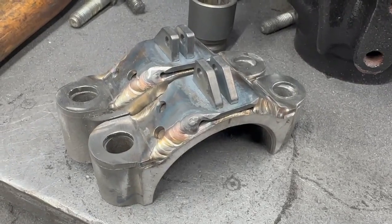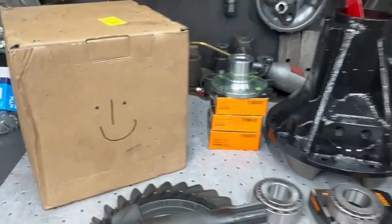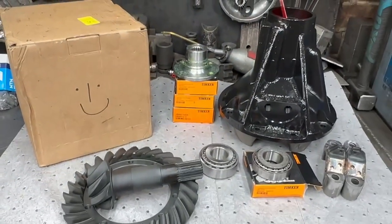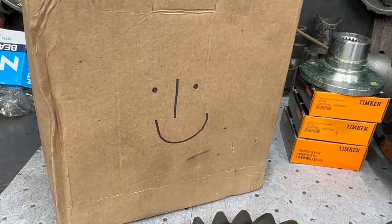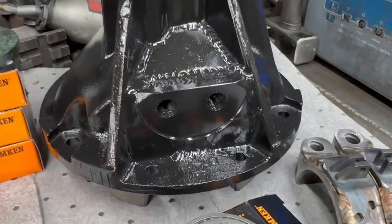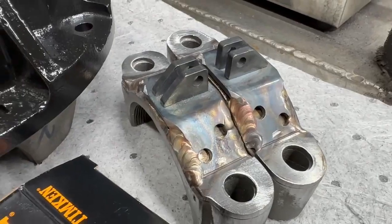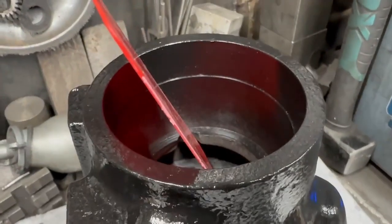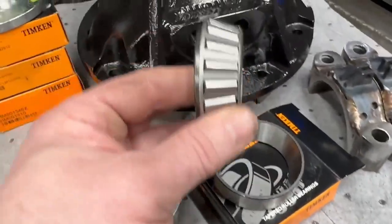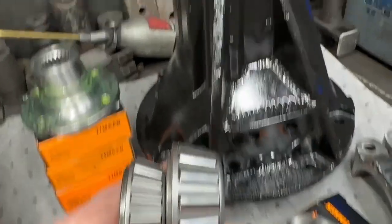It's just time, but it makes all the difference to a stronger diff. I'm going to run you through it really quickly. Here we have the main components and the special bit in the box there. This is one of our ultra spec peg diffs — so not only is it a peg casing, it's got collet caps, it's got a Domex carrier cap conversion, it's also got our big bearing conversion in the tail end.